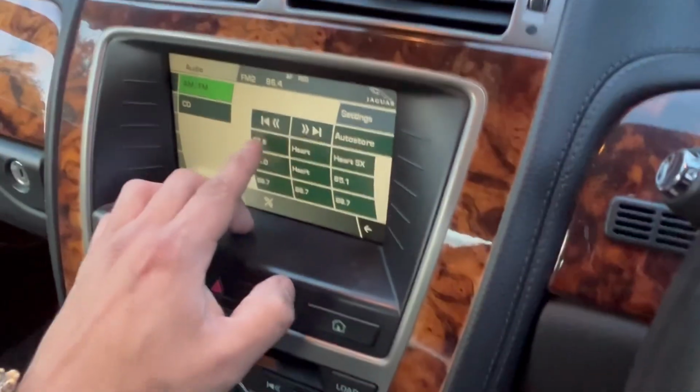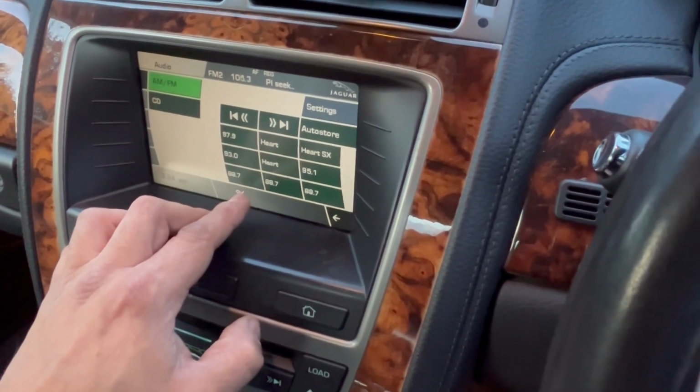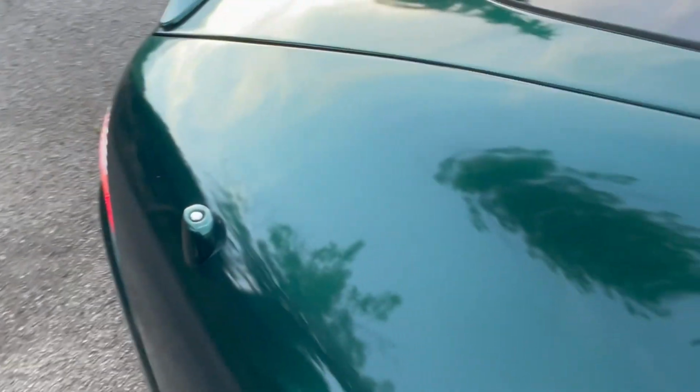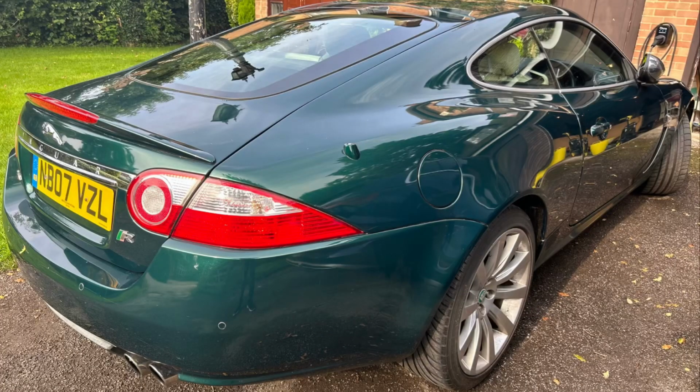As you can see, I've just started the car. I don't have radio. I've taken fuse 4 out, and you can see that the aerial is no longer coming up with the radio on. Job done. So there you have it, I've got that aerial to stop coming out. It gives the car a much smoother silhouette, even when I'm driving it, and I don't feel like I'm driving a radio controlled car or an electric Dodgem. And I needed no tools at all for this job. I just pulled out the cover, took out the fuse and pushed the cover back in again, and that's sorted.